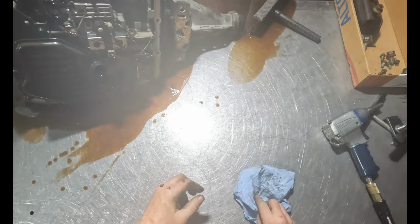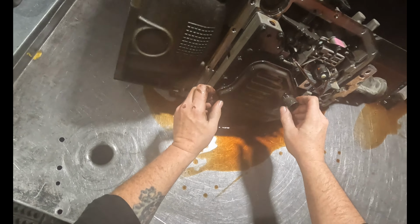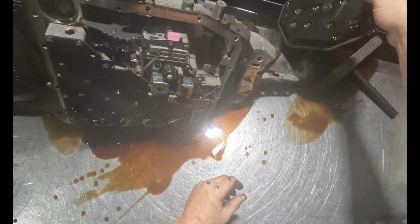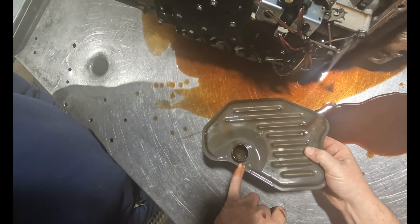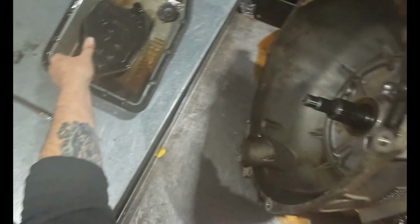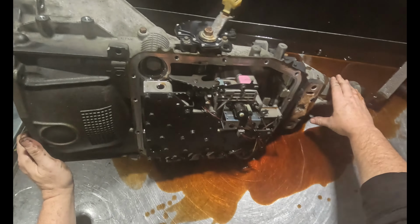It's definitely hurt. And it's a soft wire because it's updated. Because it's a 13. Yeah, the filter's pretty loaded with metal too. I'm looking down in the hole. It's just hard to see, but I can see a lot of metal in it. See the flake? So the filter's clogged up pretty good. It definitely gets a new filter, yeah.